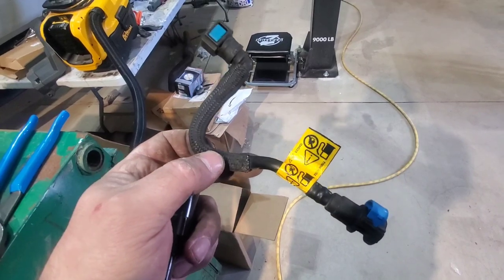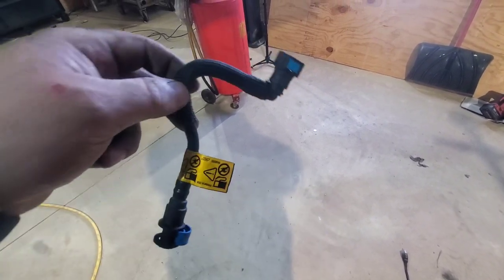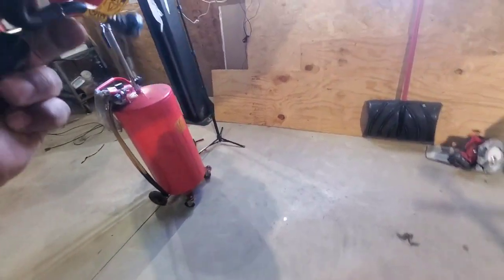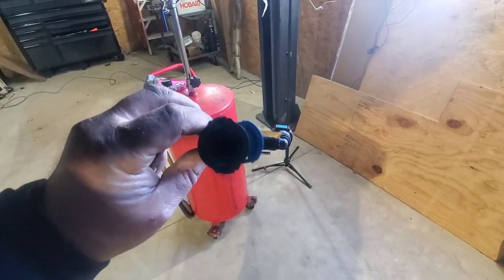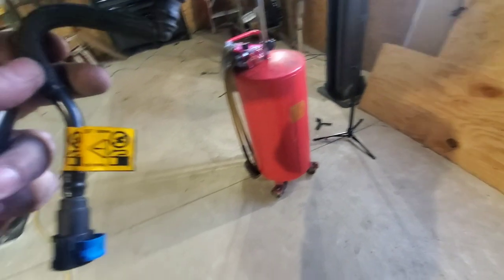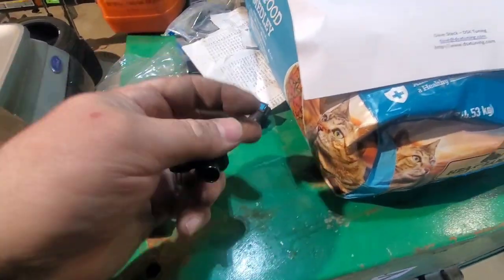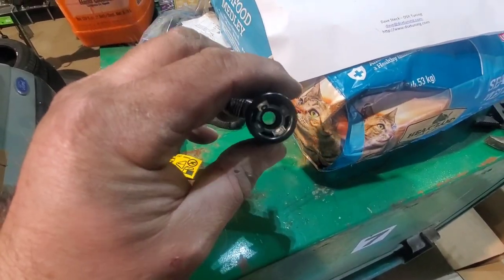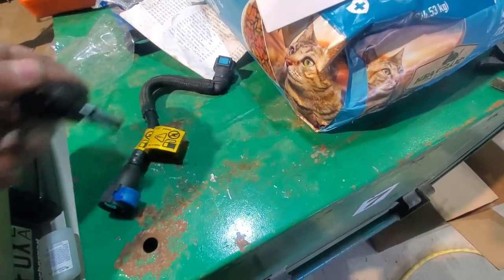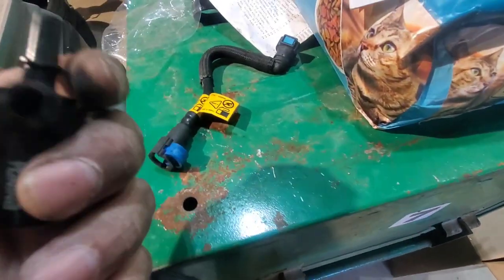I got this — what they call the jumper fuel line — out of the car. At first, because I didn't read the instructions good enough, I was like it doesn't fit. But what they want you to do is flip this around. Originally it's like this where this is in the front and this is in the back, but they want it the other way — so it fits that way. This just snaps on to the steel fuel line, and I know that fits because I already tried it. It fits this side but not the other side because when you put it in there it just won't close on the stock rear fuel line.